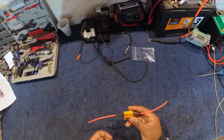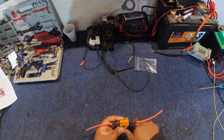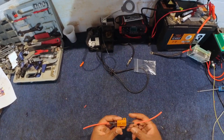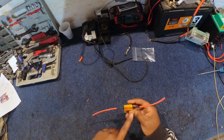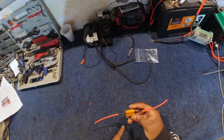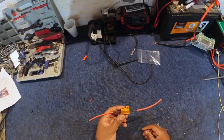Basically, what this is here is a soft start — so when you connect your battery, it slowly lets current into the capacitors, so when you switch your breaker on it's not so much of a headache for the controller to handle. So yeah, basically today this is an inrush current pre-charge resistor and we're going to do a quick tutorial on how to fit this to your bike.